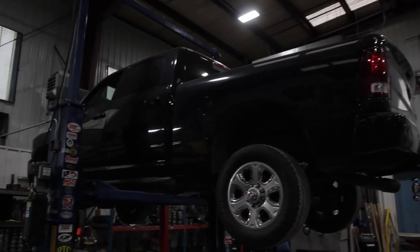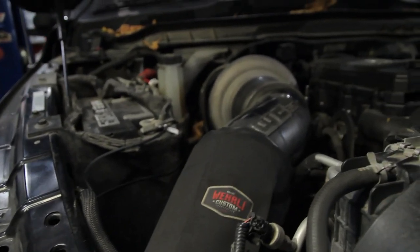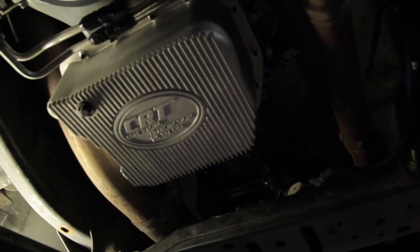What we got is a 2015 Dodge Ram 2500 series that we're doing a 48 swap on. The motor's making about 500 horsepower. It's got a second gen turbo on it with a 67 millimeter turbo. We're gonna lift the truck up to show you a few things that we did to the transmission internally. This particular customer decided to go automatic. Most of the swaps that we do are reverse manual and reverse manual trans brake, but this customer wanted an automatic shift.